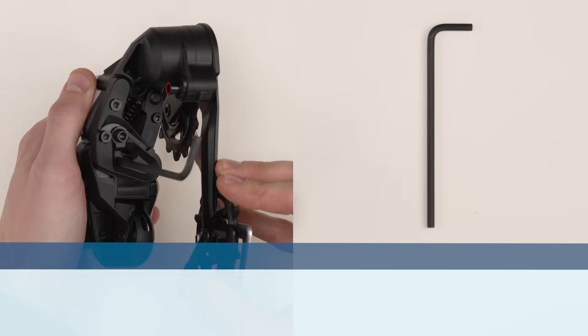Make sure the hex tool is keyed and aligned inside the hexagonal cutout with the flat sides of the tool against the flat sides of the cutout. You must use a hex wrench that maintains the shape of the hex head. Do not use a ball-shaped hex wrench or rubber-coated arm, as it will change the position of the setup cog resulting in poor shifting performance. Do not rotate the tool while installed in the hexagonal cutout, as this may damage the actuation fin.